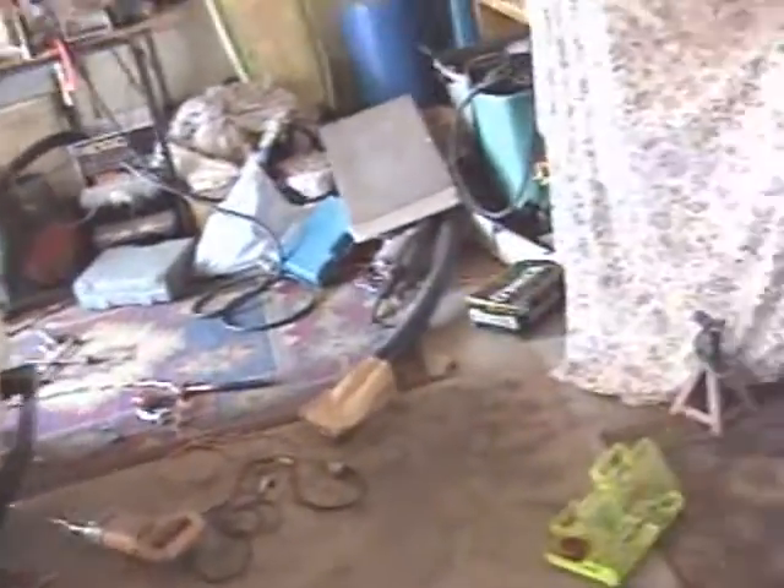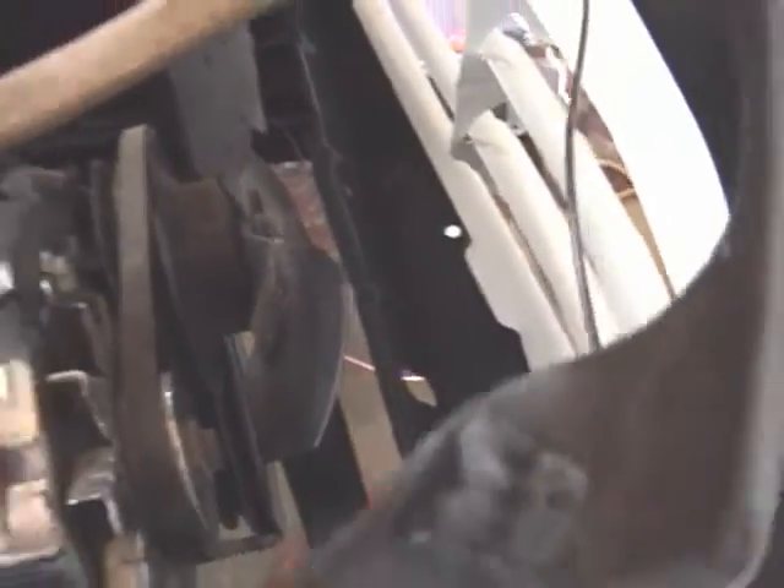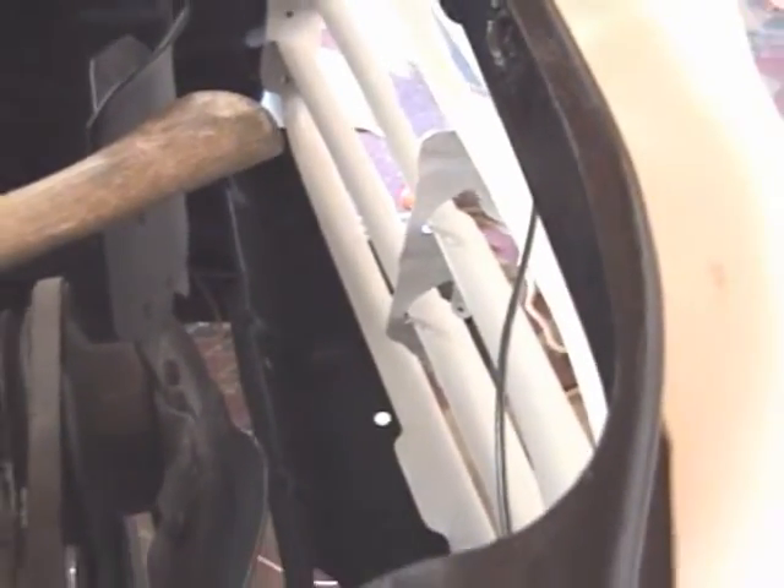After a lot of sweating and scratching up absolutely everything I painted, I got it on — bolted up somewhat, except the face. But now I know what I gotta work with, and it's this little tiny space in between there. See it? I'm probably gonna have to go with an electric fan. Down there on the bottom where the grill butts up, I marked it with a pin. The important thing is I can see it. I know how much space I gotta work with. Hopefully it'll go in there — Joey and I did mock it up once and it did clear.